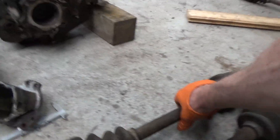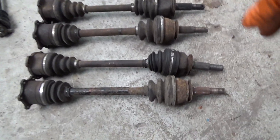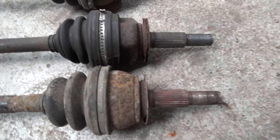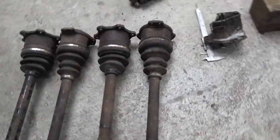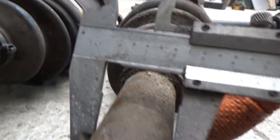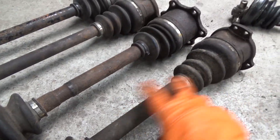Looking at just the size of the shafts — you get a long one and a short one — and the splines are the same on both the 350Z and S14 axles. There is a slight difference in diameter though: the 350Z shaft measures 30mm, and the S14 one is slightly smaller at about 28mm. So the S14 ones will be slightly weaker — I don't know by how much but there must be something in that.